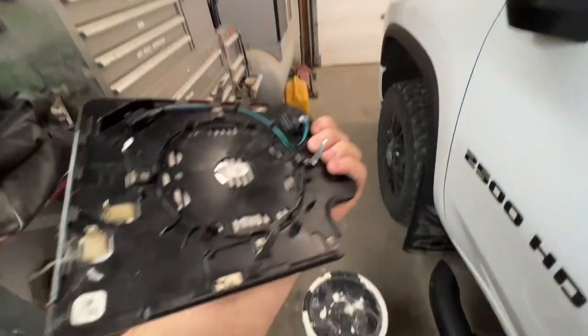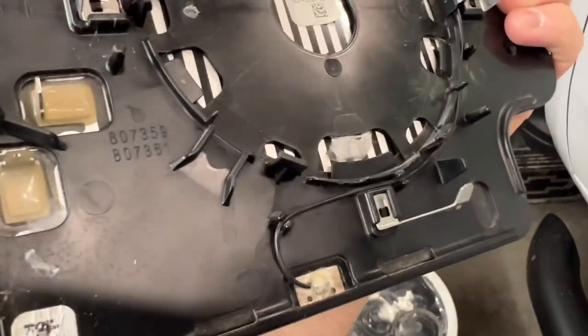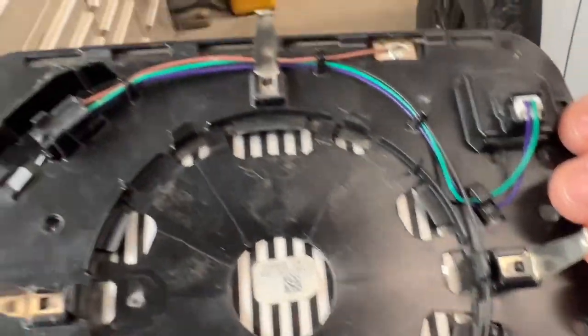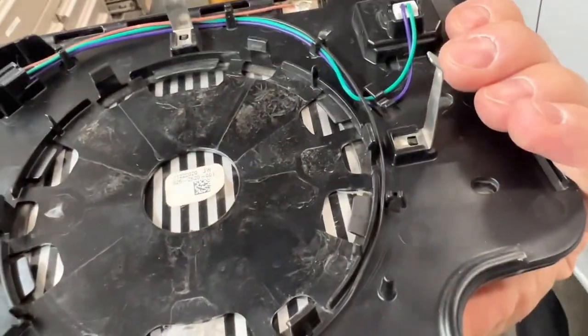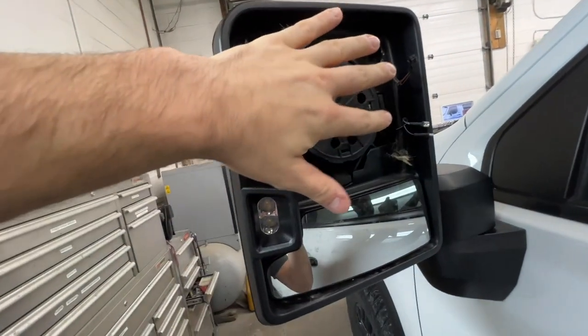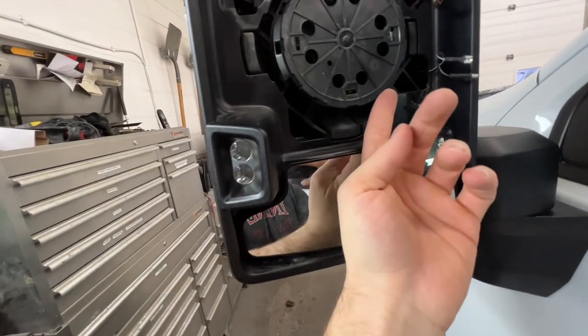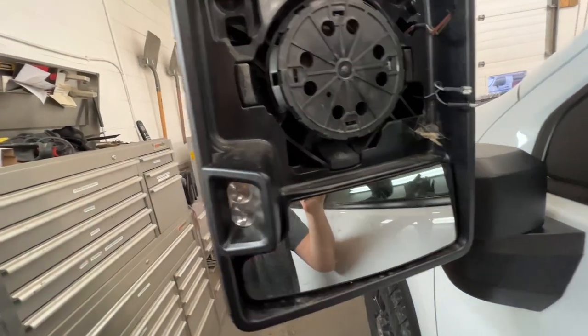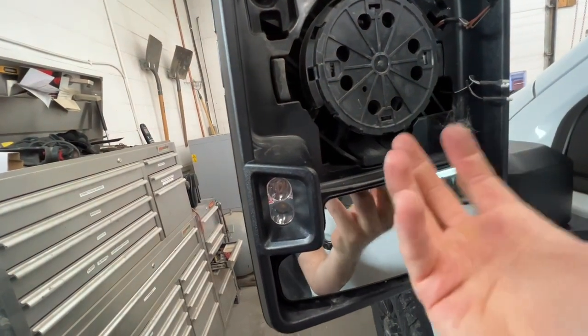You have to be very careful because the first thing we need to do is remove the glass out of the mirror. I already got the top one out. There's a tab right there and right there on the side, and the same matching tab on the bottom. You really only need to worry about the bottom. I took my hook, tipped the glass up, and right here is where those first two tabs are — I popped those out, then you can get your fingers in behind.